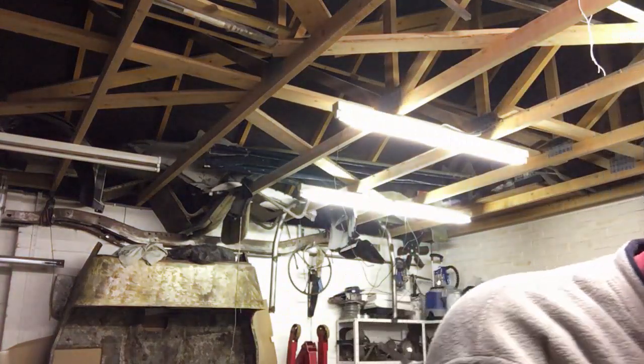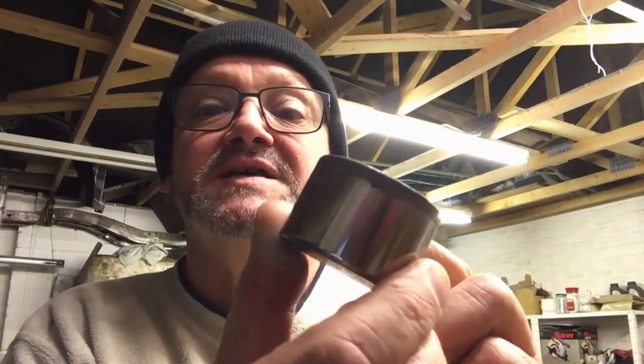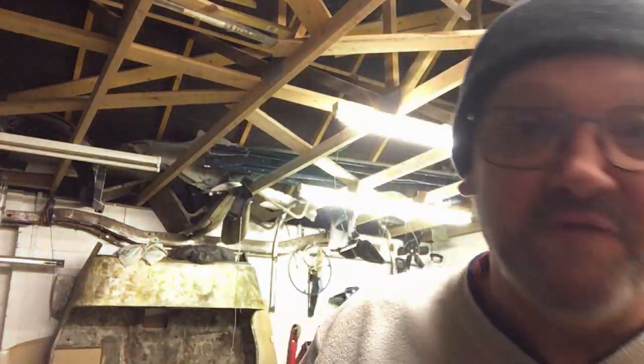The other thing I've done - I've removed the brake calipers and found that all eight pistons are rusty. There they are - you can see how badly rusted that is. 16,000 miles, nine years old, knackered. So I've got the Brit Part stainless steel brake piston seal kit on the way. I'm going to give the calipers a nice coat of red paint and get those painted later on.